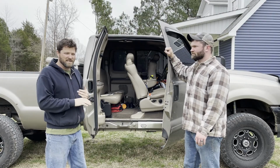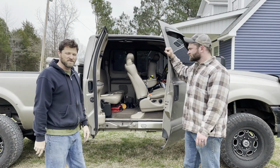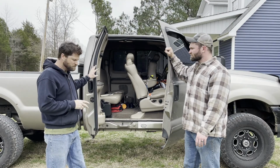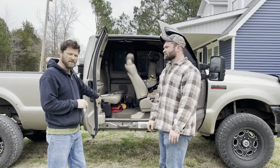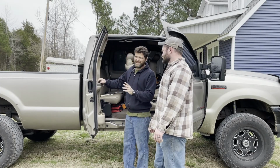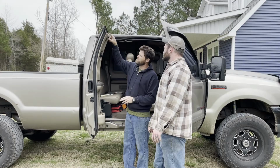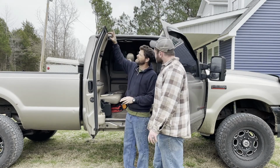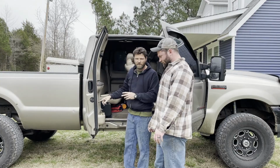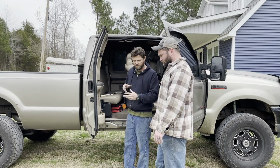So, on a skill level, if you've got a T27 Torx, a 7mm, quarter-inch drive, and a little time in your driveway, you could probably do this whole job in about an hour, both doors. I did have one viewer ask me one time about their cables broke, and they couldn't even open the door even once they got inside of the panel. So if your door's closed and you were trying to get into it, once you remove this upper panel, there are 3 screws at the top of this. You could probably unscrew those from inside of the truck to break this upper latch loose, and then the bottom one you can actually reach down through the speaker hole and probably pull the little lever that's on that mechanism down there.